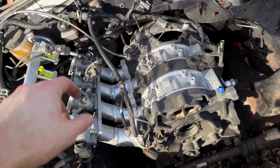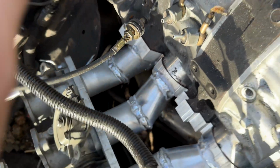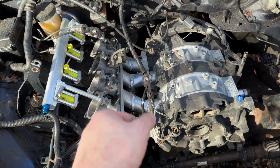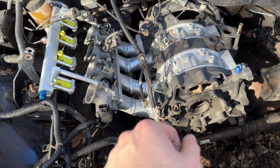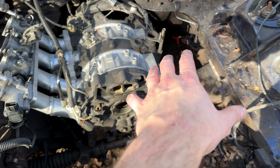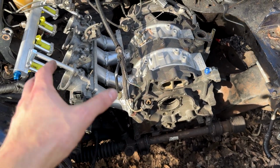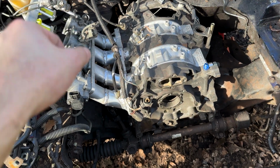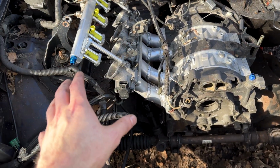Again, it's just nicking at this corner around here, so I might get a blowtorch on them, heat them up really hot, and then pull upwards. The engine mounts, the bushes are just sat there at the moment, they're not actually bolted in, so it might change a little bit. So I think I'm going to borrow the blowtorch, get it really hot in the week, and then pull it upwards. So the engine's going to stay there for now, the intake manifold's going to stay there for now.